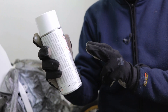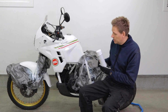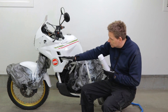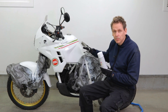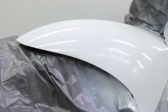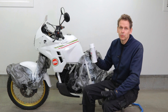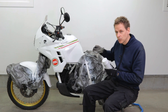Don't use it on your bike build. So why do I use spray paint? I'm just doing some touch-up. I have these tabs here that were very rusty and I put on a coat of primer first and then painted with this. The front fender paint was starting to flake off - it had been repainted at some point, probably done a poor job on priming and sanding, so it was shiny underneath and the paint started to peel off. Better than nothing for minor touch-ups.